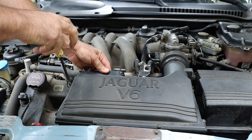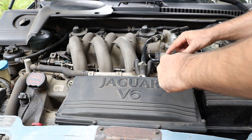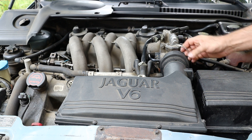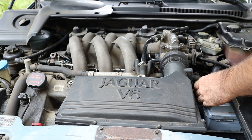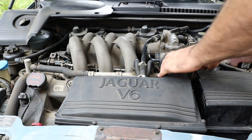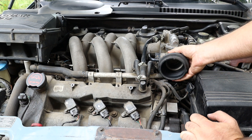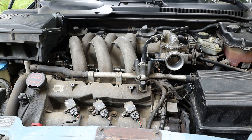We really cannot do without it. I go on removing the airbox. I remove both clamps of the manifold to airbox hose. Temporarily I remove the battery cover to have better access to the mass airflow sensor and unplug it. I just removed the airbox completely — it saves both my time and the threads of the airbox screws. If you watch this video to the end, you'll get to know how to remove the Jaguar X-Type airbox completely without taking it apart.